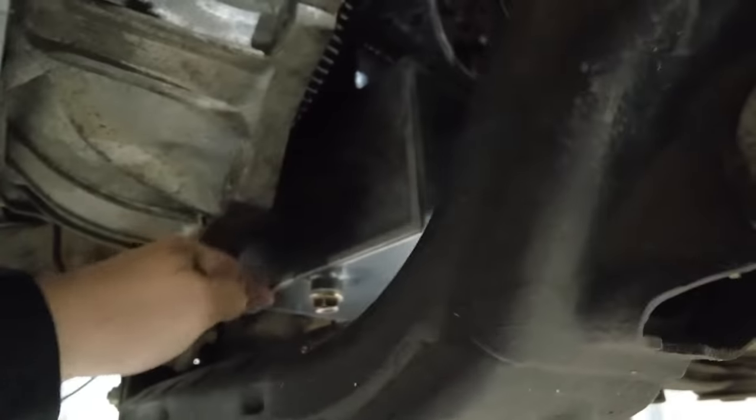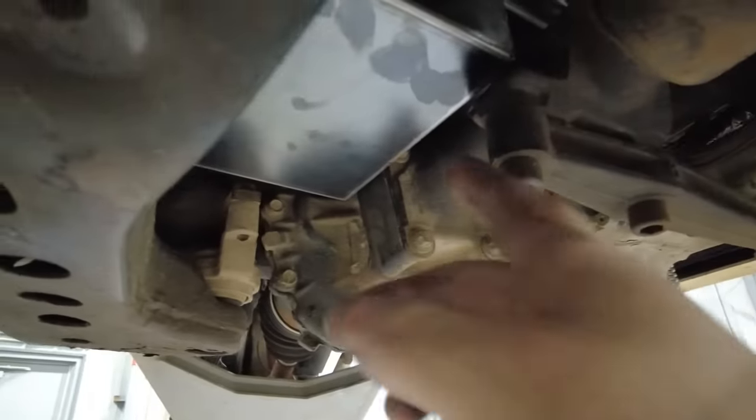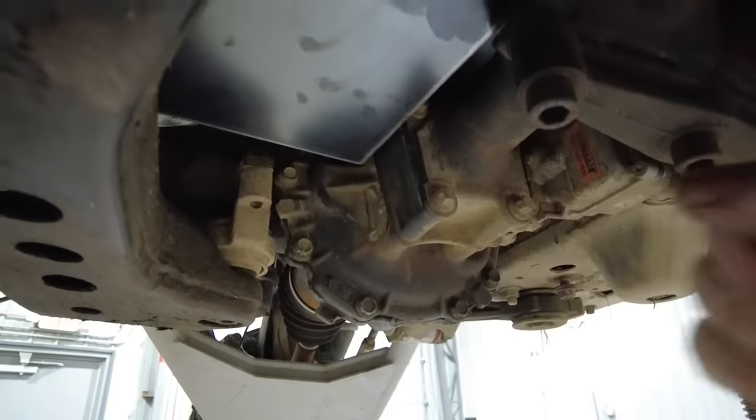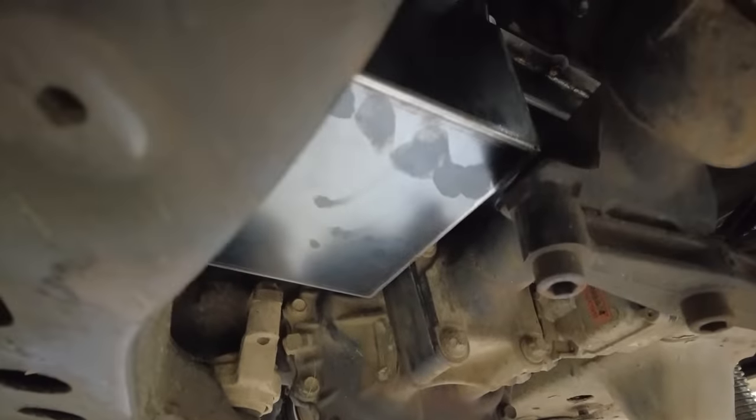It's going to come back. Obviously, as you can see there, that side's sitting on the mount as well. And everything looks good. The pan fits down in this space perfect. It's above the cross member. As I said, it's going to come back a bunch here. It's real close right here, but the whole engine's going to come back this way quite a bit, probably 2-3 inches.